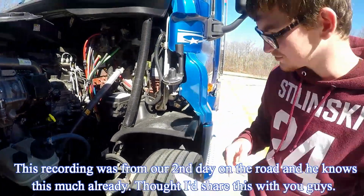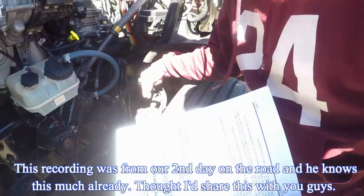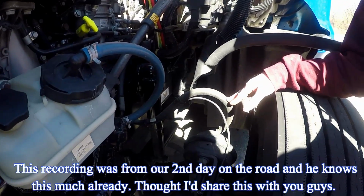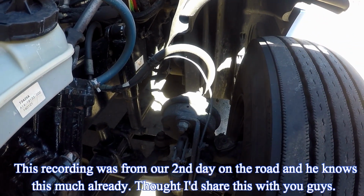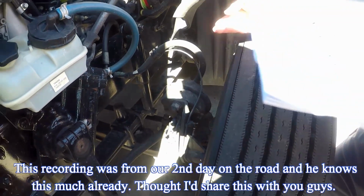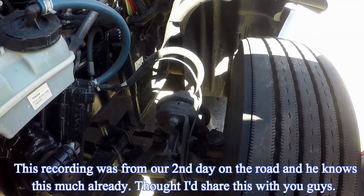Brake chamber and hoses. This is the brake chamber, right? This here? Nope, here. Nope, the brake chamber is that one. This one? Yep, and that's the brake hose right there. Properly mounted and secured, not cracked, bent, or broken, and not leaking air. And then I do the same thing for the hose, right? Yeah. The hose is properly mounted and secured at both ends, no abrasion, bulges, or cuts, and not leaking air.